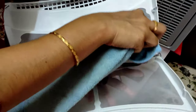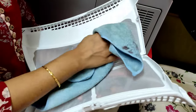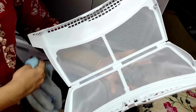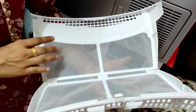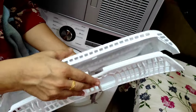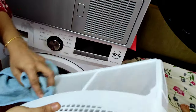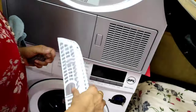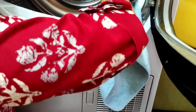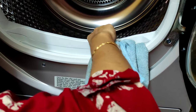This is the lint collected from the clothes — you just wipe it off. You have to clean this filter after every cycle. If it's not clean, it will get clogged. Make sure you clean it every time, because the lint needs to be removed — otherwise the machine won't be able to pull in cold air, it will overheat, and it might become a fire hazard. Also wipe out the surrounding areas where lint collects.